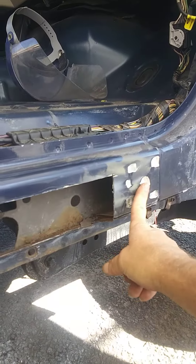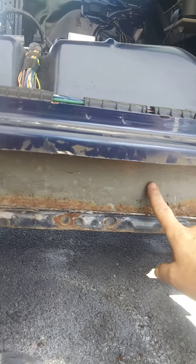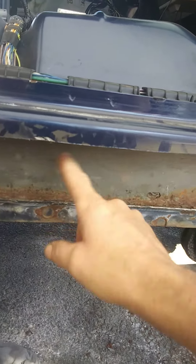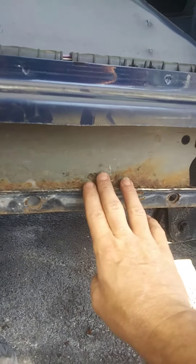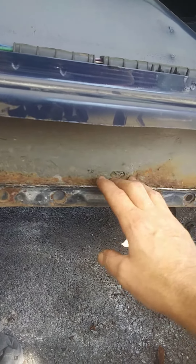Like I said, you need these edges for welding the new piece on. I've seen other videos where guys put a piece of eighth-inch steel here — I'm probably gonna do the same thing — because I want to eliminate these holes, because that's how the debris got in here and started my rust issue.